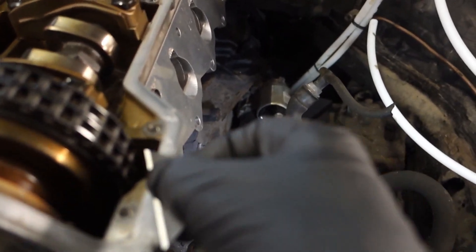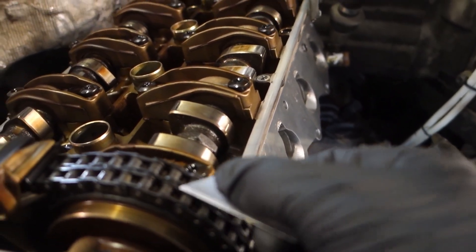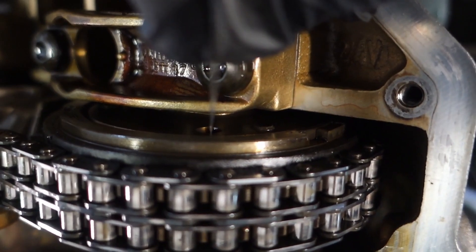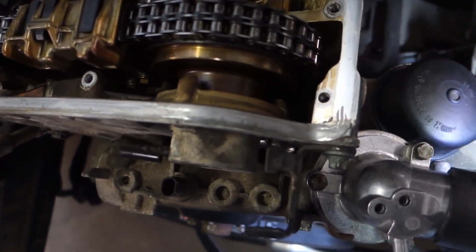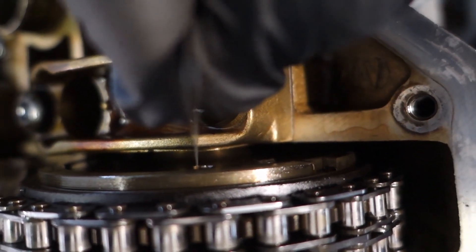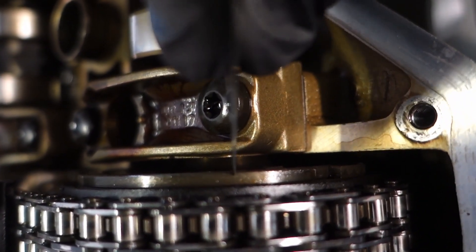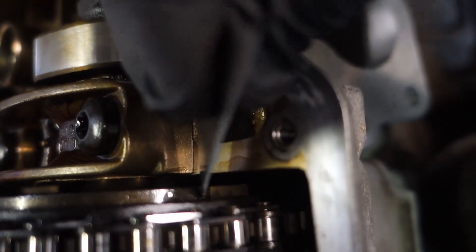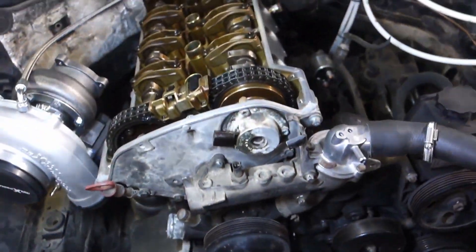Let's check the intake. Same thing — flat on the surface, now count 6 teeth: 1, 2, 3, 4, 5, 6. Those 6 teeth must align with this hole. If the camshaft timing is wrong — for example, advanced all the way — then you'll see this hole in a different place. It will align not with tooth 6 but with tooth 5. You might think the timing is wrong, but really the camshaft just isn't fully retarded. So make sure the camshaft is all the way retarded. If I advance the camshaft, the 6th tooth no longer aligns with the hole — the 5th aligns instead. So my timing is correct.